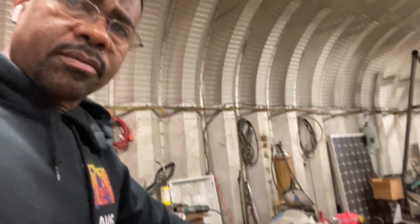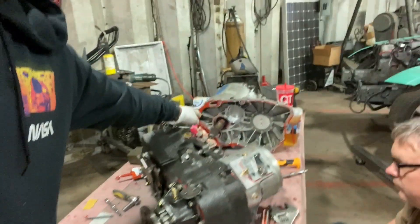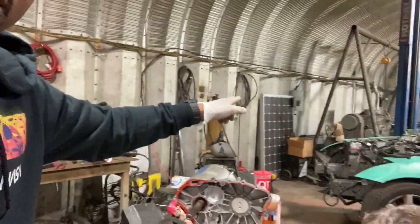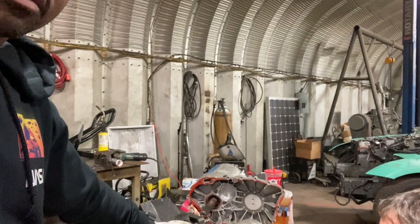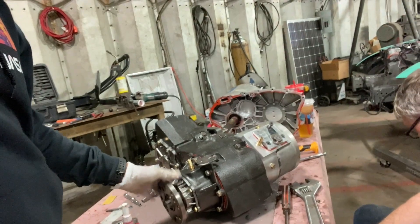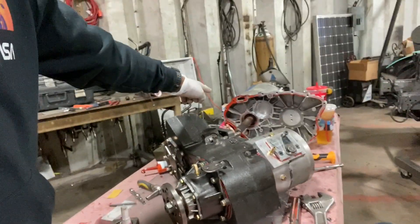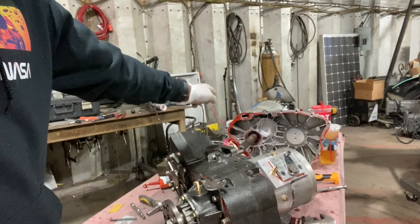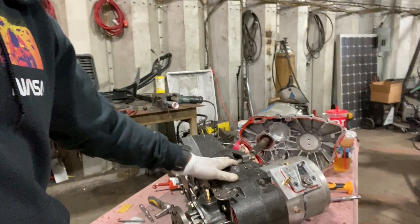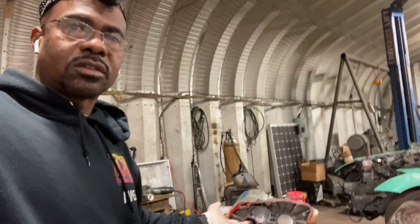What we're going to do now is — looks like from our bench test — take the shaft out of the motor, put it inside the transfer case, put it on the lathe, spin it, make sure it doesn't have any grind. We'll put some resistance on the output shaft like we did before to see if it pops out of gear or grinds. After that we're going to bench test the motor individually to make sure it doesn't have any malfunctions, and then we'll test them both together outside of the truck, and eventually put them in the truck to see what happens.